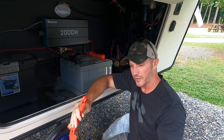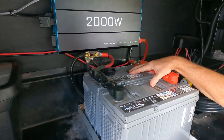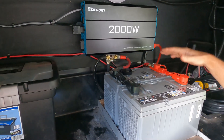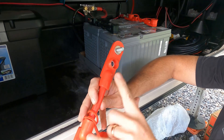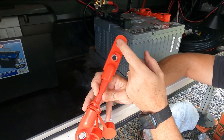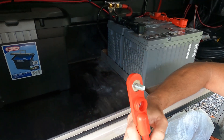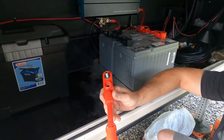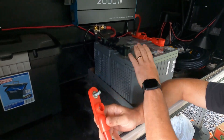The jumpers I'm going to use to hook these batteries together — as you can see, the battery bank inside our fifth wheel currently is a pair of Northstar Group 31 AGMs wired in parallel, with the negatives hooked together and the positives hooked together. The jumpers I'm using allow you to wire your batteries together with a stud coming out where you hook up all your connections, so you're not trying to cram a bunch of wires on one battery post. I've already test fitted them on top of the Uniwix batteries and they fit perfectly. It should work out just the way my Northstars are in there.